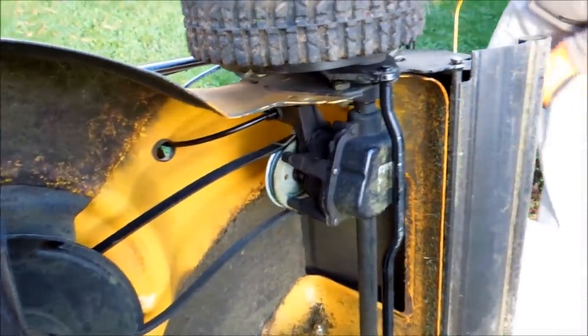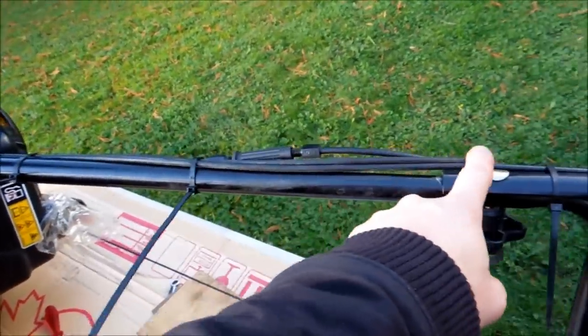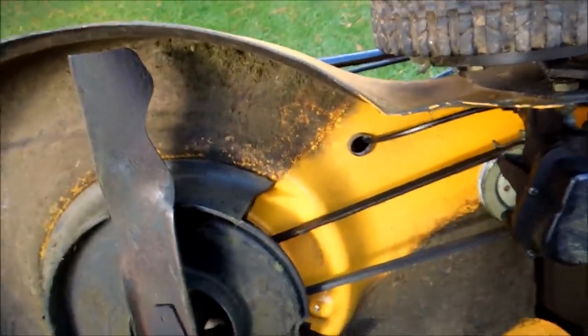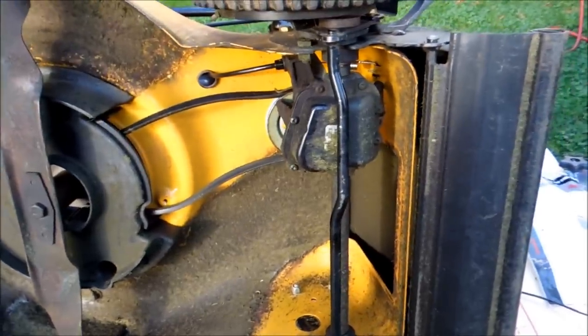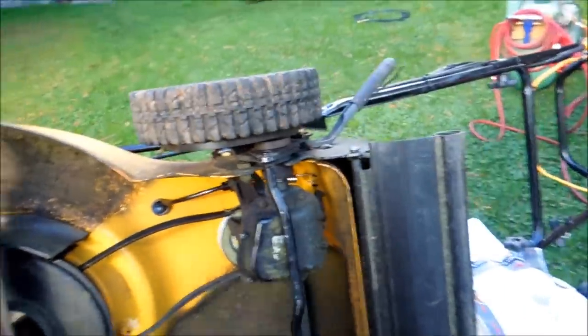Pull on there and you can see. All right guys, so one last thing — as you can see, I just redid three tie straps here, all nice and tight along here. Now if you look, he's going to pull on the lever up there, and as he pulls you're going to see this get super tight, and that's what you want — you want it tight so that way it drives the motor. So now that we know the drive motor is engaging, the other thing you can do is a dry test: once it's all done up, put it down on the grass, start it, and see that it's cutting. That's the best way to check. Everything's cleaned up in here, no debris. Now you can finish putting it back together.